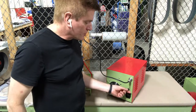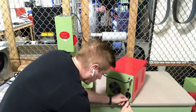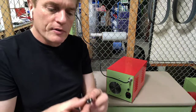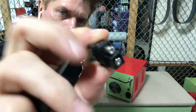On the back of here, there's two fuses — a fuse here and a fuse at the power input. With the cord removed, you get a flat-band screwdriver and that slips out this little fuse holder. You'll note there's a fuse here and there's a spare fuse in there too, inside that little holder — there's my spare.